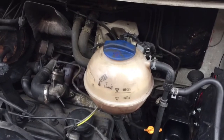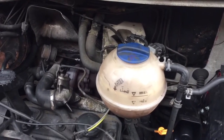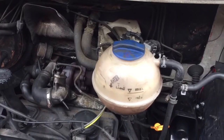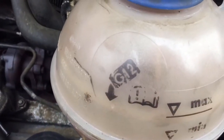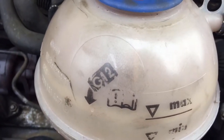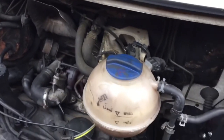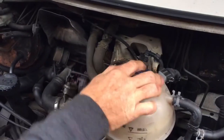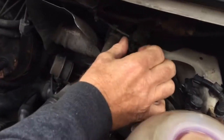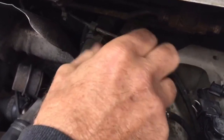Back here at Pete's garage, another video for the Monkeys Uncle Dubs Club. Just topping up the antifreeze — my water pump broke recently, so we've repaired that. What we need to do now is put the G12, which is the Volkswagen recommended antifreeze coolant, in. Pete's kindly going to show us what he's going to do and how to do it properly. There's a little screw up here that's used to bleed the system that I wasn't aware of.